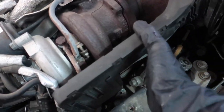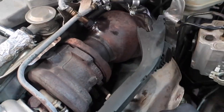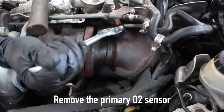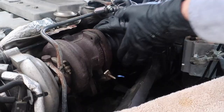Okay guys, so we are now under the car. This right here is the mid pipe, and right above that is the down pipe. There are three bolts — two right here and one on the other side. We're going to remove those three and then there's another piece right here. After that I think we have to do this other heat shield right here under the down pipe — I think there's only one 10mm holding it in.